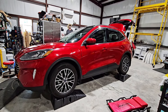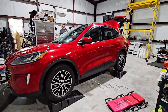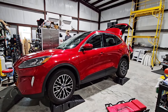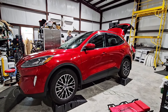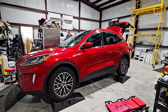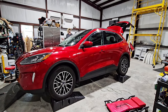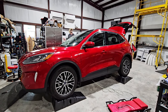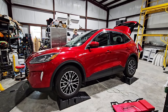After the wiring is done, you're pretty much done with the tow vehicle - everything else will be on the RV. The tow vehicle will be done when I finish the wiring today and get the diodes installed, then test it behind something with a seven-way connector. The kit from eTrailer has a seven-wire connector on the RV end but a six-wire on the towed vehicle, so you have to test that the lights do what you want - turn signals and brake lights.